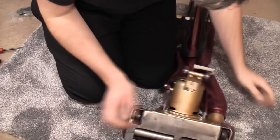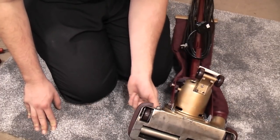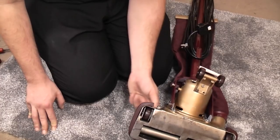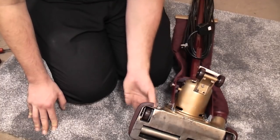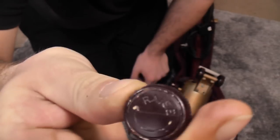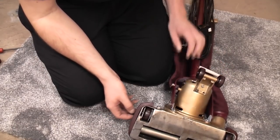I took all the paint off the wheels. The adjustable knob — if I could take it off and show you it completely... there we go, I unseized this, cleaned it all out, it's got a bit of grease on it so it's a little bit sticky to hold. But there is the original red Bakelite adjustment knob. Very nice indeed. The rear wheels now spin — one was completely seized up as you can see from the wear mark on the wheel. A good soaking with penetrating fluid did the job.